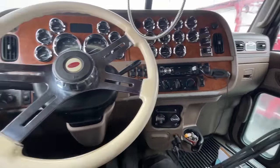Now I have a load on the back right now, so we're gonna start it in just low gear, okay? Now, what you wanna do is push the clutch down all the way to activate the clutch brake. If you don't do this, you just push the clutch a little bit, when you go to shift into gear, it's just going to grind. You hear a bunch of people in the truck stops that just grind until it gets into gear. That is a big no-no. Push your clutch all the way down. Engage the clutch brake and it just drops right in.